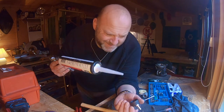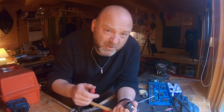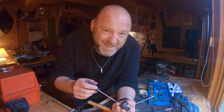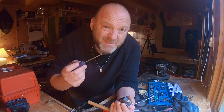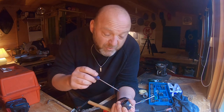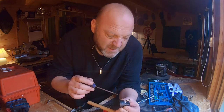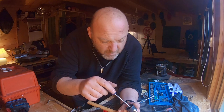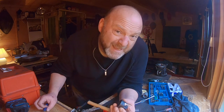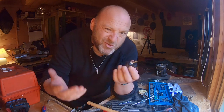Many of you might be asking why I'm putting silicone when I've already got PTFE tape on there. The fact of the matter is I don't think I've done a very good tap and hole - it's hard plastic, a little bit fractured on the edge. So I'm just trying to make it doubly sure.